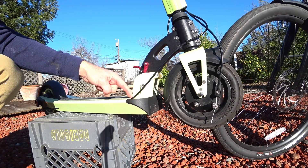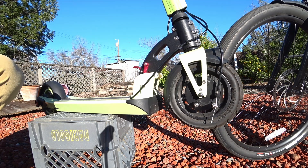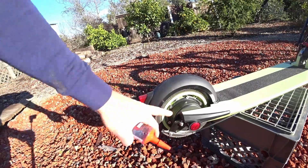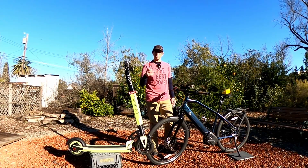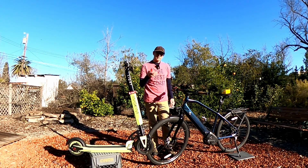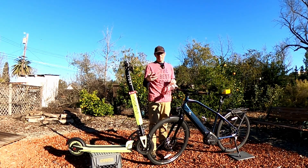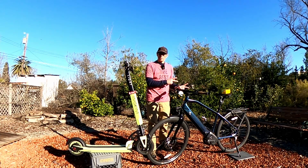I'd check whether any hole is just in the side of the scooter, because you don't really want to caulk a big hole with a cable going through it — that's probably not going to work out very well. The motors are almost always well sealed — you can actually see the caulking right there on this one. With drum brakes, you can't really do anything about the brakes. I don't really advise doing caulking on bikes unless it's just a couple of spots — maybe on the down tube. You could go around the motor casing potentially. Most bikes have plastic-to-metal connections that aren't very weather sealed, so you're really hoping that the internal parts — the controller, the battery — have waterproof connections to prevent water ingress.